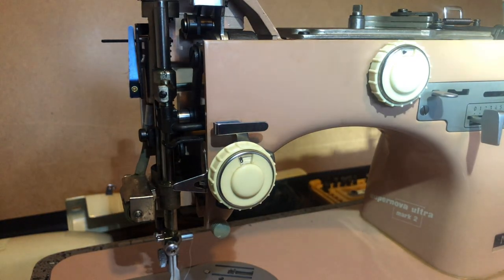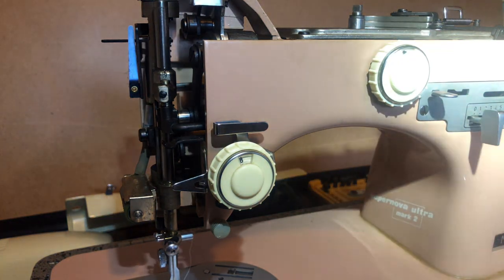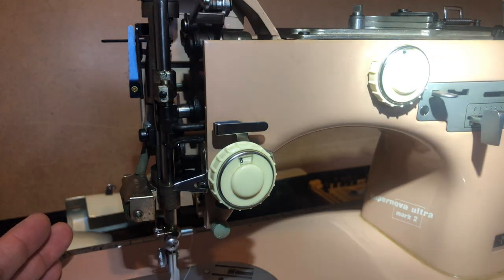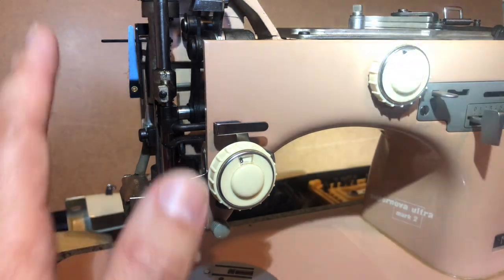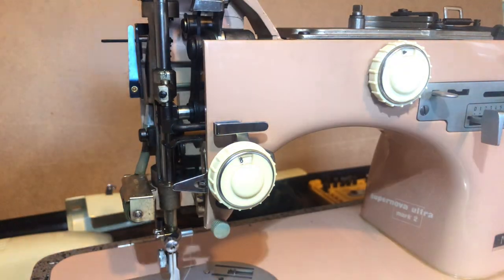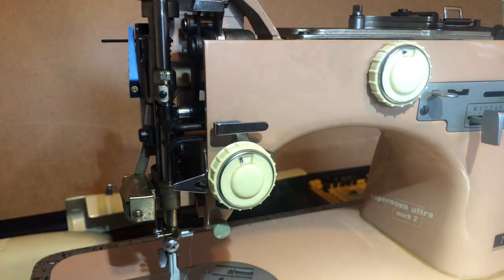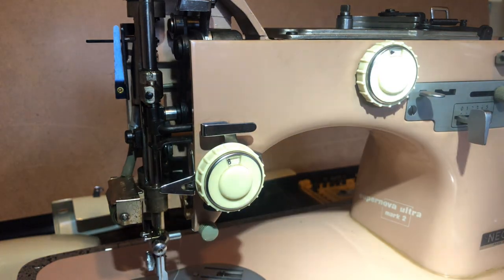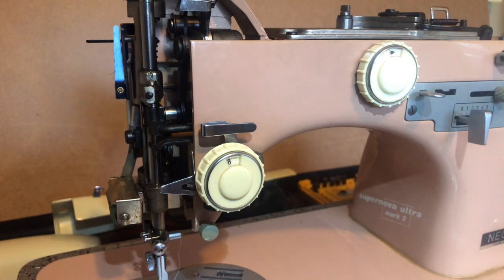Now I've moved around toward the front side. This is something that often trips people up when they're first starting to restore a sewing machine. If your machine is going to freeze — this one is not frozen — it still gets the same care any machine gets, even those that are frozen. It moves and it's very pretty, but it needs to be cleaned of lint and lubricated. You go through the machine at all the checkpoints as if it were a basket case, because you don't assume just because it looks good that the machine is ready to sew. I cannot just sell this to someone and say take it home and have at it. This machine is not ready — it's been asleep, and I'd say at least 20 years.